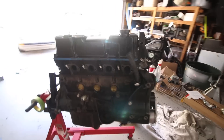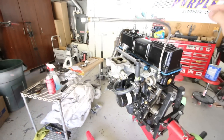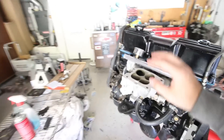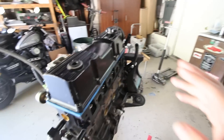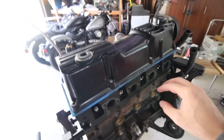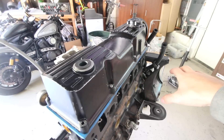What is up, Team Boosted? Welcome back once again to another video. Today, we get the turbo in for the Datsun engine, which is a 1988 Thunderbird turbo coupe motor. The reason we're getting a new turbo for this is because the old one was journal bearing, and we went to upgrade to ball bearing. Also it was too big, so it was melting the plug wires. This one is hopefully going to sit a little bit farther away. I'm a little bit concerned that we ordered the wrong one because it is an eBay turbo, and sometimes those are a little bit misleading.